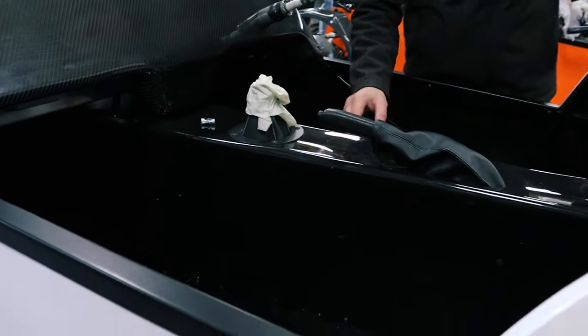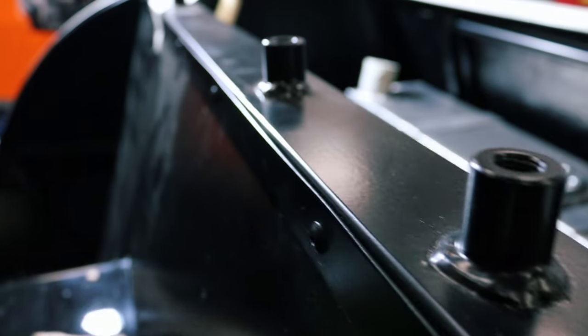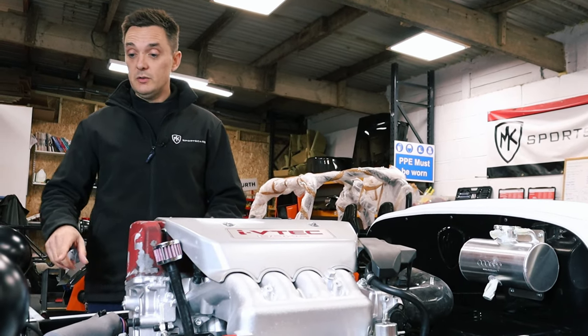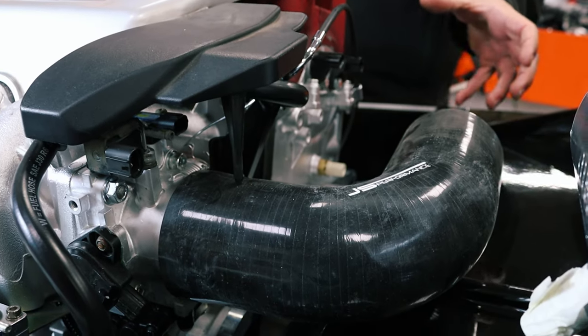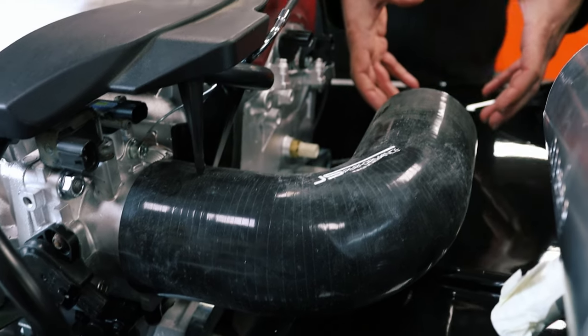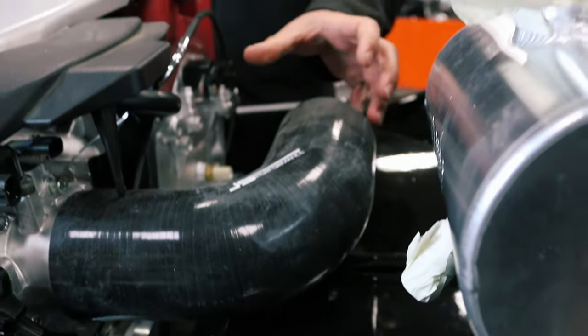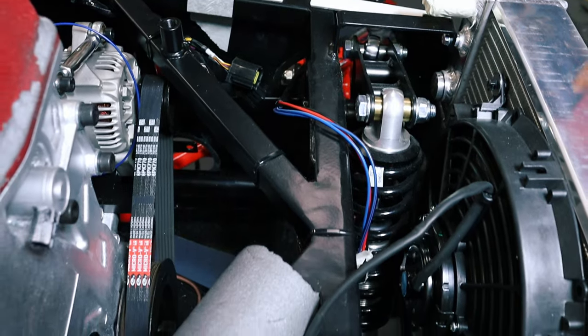The interior's started to go in - we've got our interior panels which are all bonded in now, the GRP tunnel top, radiused for IVA compliance, the handbrake gaiter in, and the gear lever gaiter in. There's a couple of little bits left to do on the engine - we've got the oil cooler coming up with a sandwich plate, ready to go in to keep it nice and cool when you're on track. We've also got the air filter to mock up, sitting about in the middle of the bulkhead. Notice the battery has moved on this particular car - we've put it down low to handle the intake air filter, so we've got enough space up top. Squeaky clean looking engine bay - really pleased with how this one's come out.